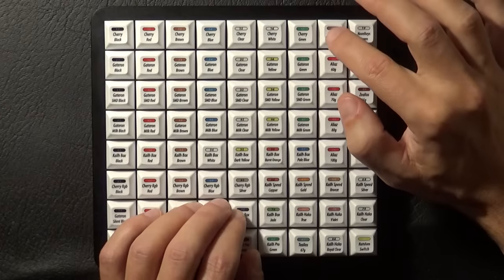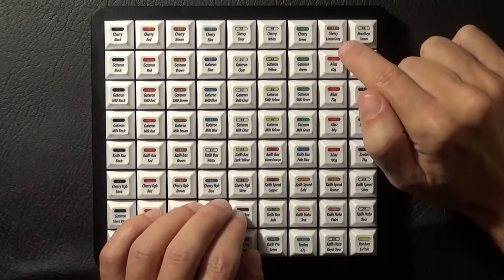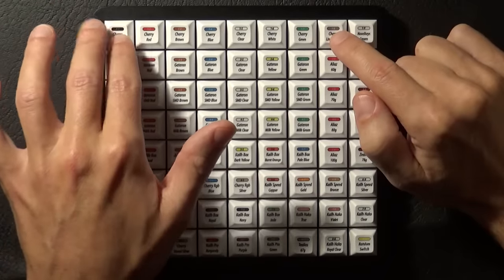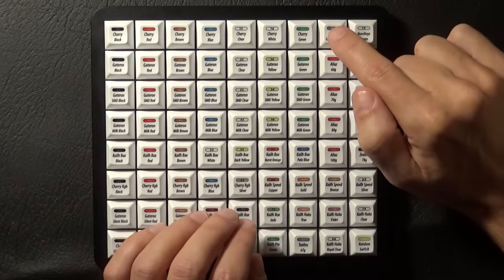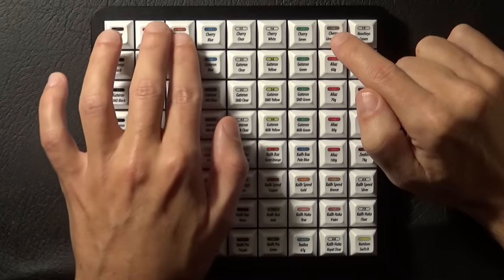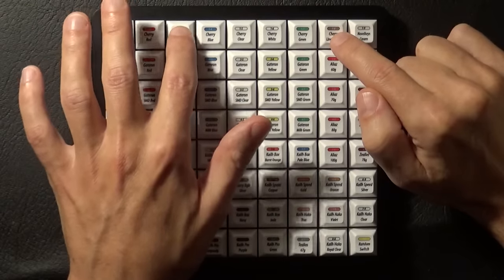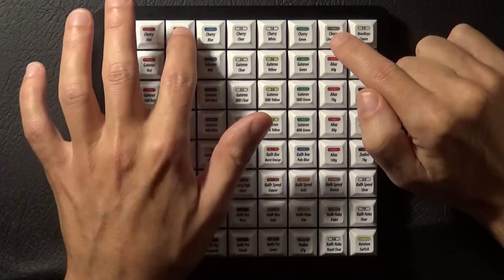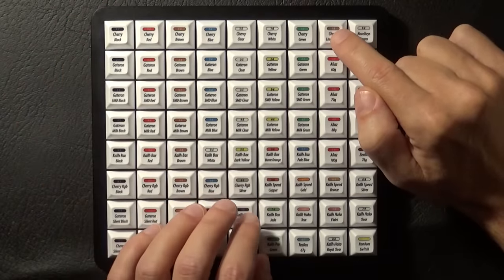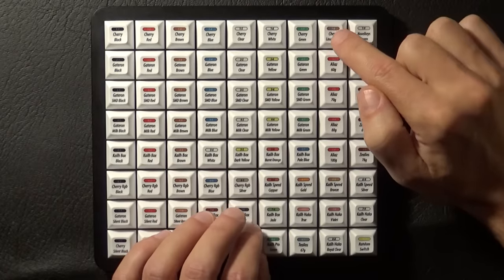Also, this one was used for space bars. At least the linear gray was used for space bars on the black keyboards with the Cherry MX Black switches. So I guess the tactile gray was usually meant for space bars on Cherry MX Brown. It's quite a big difference from 45 grams on the brown switch to 80 on the tactile gray.